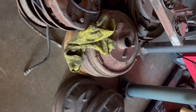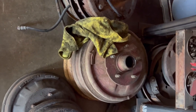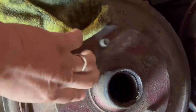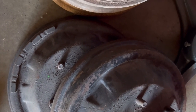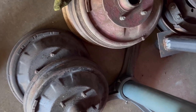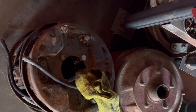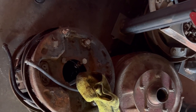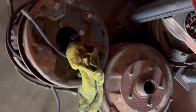I got these front drums and some rear drums as well. I'm going to remove the hubs off my existing drums to use for the coupe. The hubs I have now have a piece on top I can't use, so I got two other ones — I'll drill out the studs and replace them with new studs. I'll use those hubs for the two front drums and the rear drums underneath. I'll also pick out the best four backing plates, clean them up, paint them, and mock those up with the hubs.